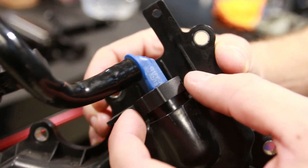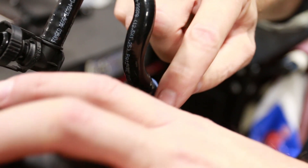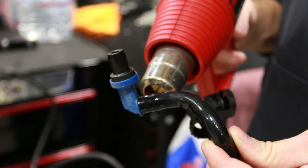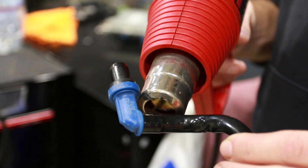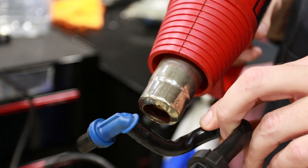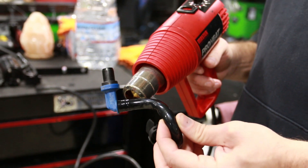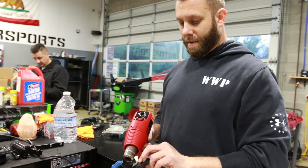We have to remove the blue piece from the stock PCV. Put a flat-head screwdriver in there, take the ring off — it's got a couple of clips — then you're able to pull it out, and this will go into the new Montune piece. Using a bit of heat, Brandon's going to remove the little tube. When I did this on Chris's car I used a fork tool and it was a bit scary, but this heat method seems like a better way. Don't put too much into it and melt it.